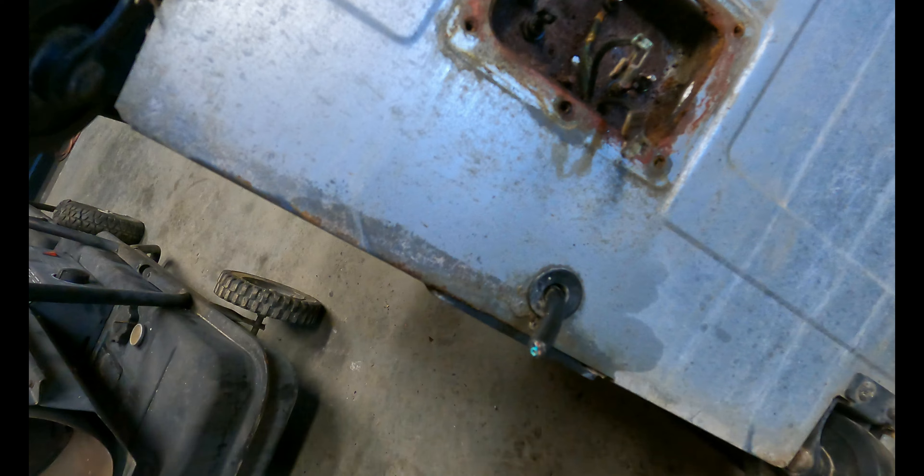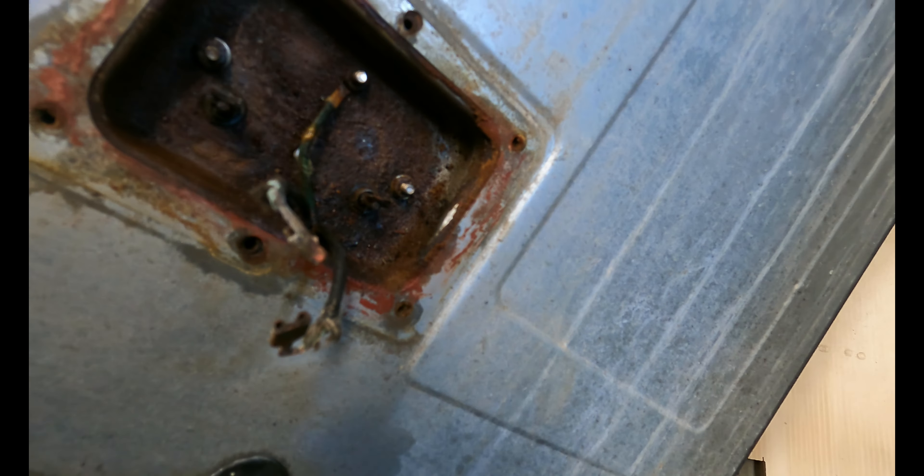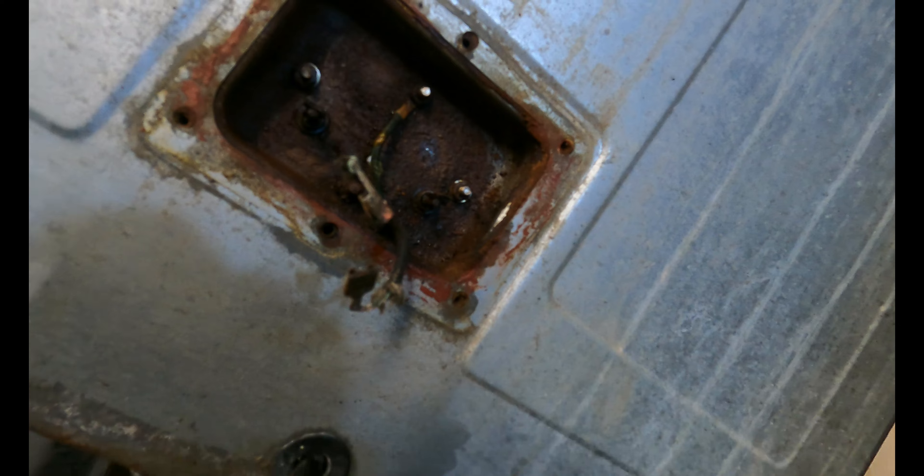So while I've been cleaning, I was going to get the element out but wanted to see why it maybe failed. These terminals that plug into the actual element are just all rotted. Don't know if the element's bad or not, but it looks like grease and other crud got in there and has corroded things.